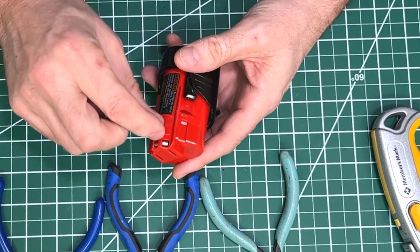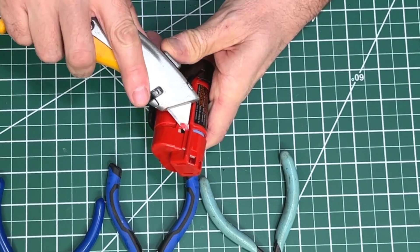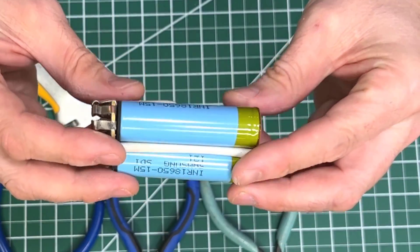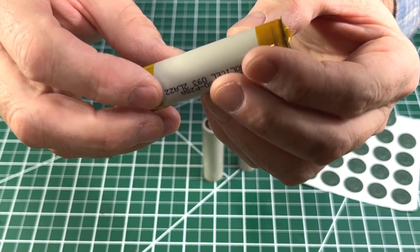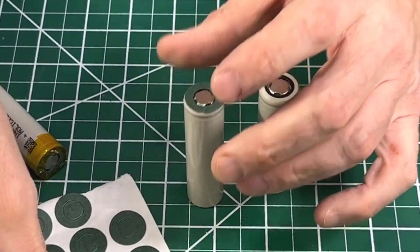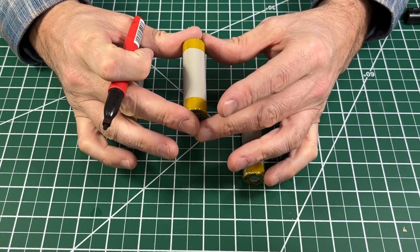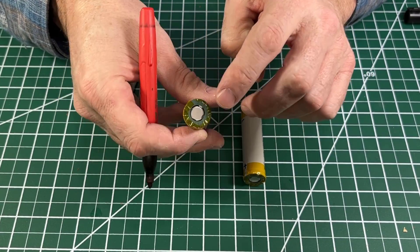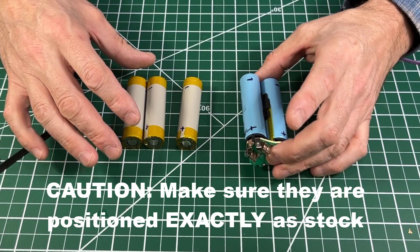The first thing we're going to do is pry this cap off the battery. To do that, I'd suggest an exacto knife — you need to get these tabs lifted. Once you're done, remove the inside. It might be a little tight if your cells have swollen, so you might need pliers to pull that out. Next, prep your new batteries with an insulator top and heat resistant tape on both sides — all three batteries will look just like this. Make sure you identify the positive and negative side of all your cells: the positive side has the button on top, the negative side is the flat end. Orient the new cells in the direction of the old broken pack.